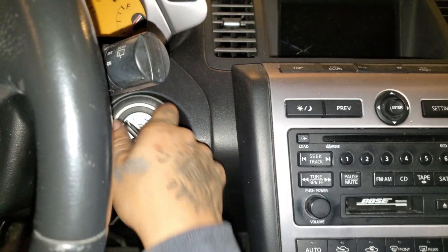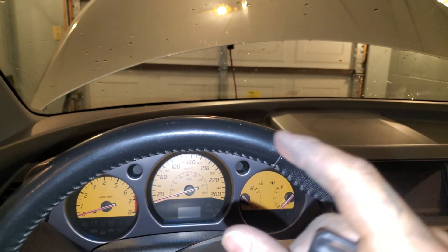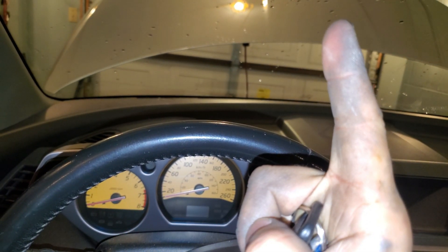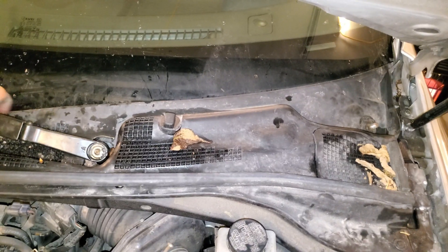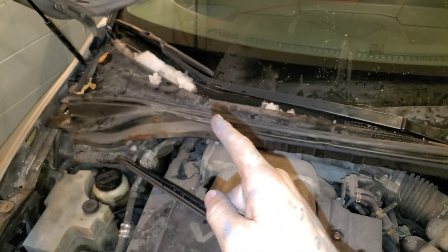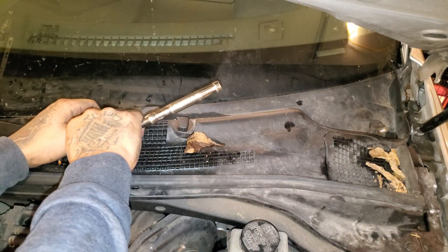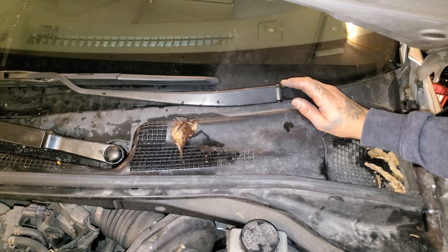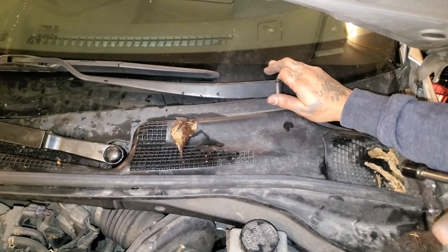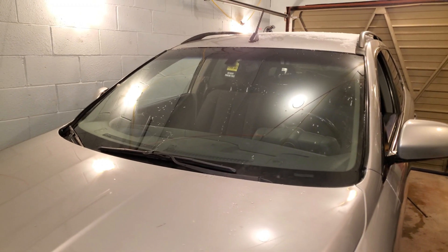Before putting the wiper blades back on, come inside the vehicle and press your wiper blades once so they can move. The whole purpose of that is to put it back to its bottom resting position, because we were messing around with the whole mechanism and we don't know exactly where it wanted to sit. We just press it once, reset it down to the bottom, and now we can install our wiper blades. Install the blade so it's on the windshield — not touching that plastic at the bottom — so it will go to its original position without going too low or too high. Ratchet it in place, put the cap on, then do the same thing on the driver's side. Put the 14 mil nut back on, ratchet it down, put the cap back on, and shut the hood.